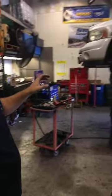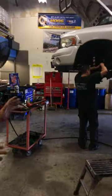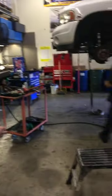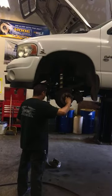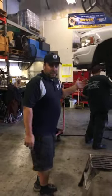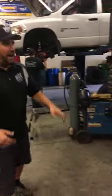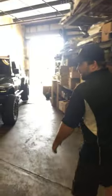This is our guy Doobie — and yes, his name really is Doobie. He's doing ball joints over there. We're doing the 09-and-up steering box upgrade on this truck, which is a much bigger steering box. He's getting the new tie rod, new drag link, new ball joints, new U-joints — basically a full rebuild on the tow rig. A lot of people don't realize we do in-and-out diff service like this.